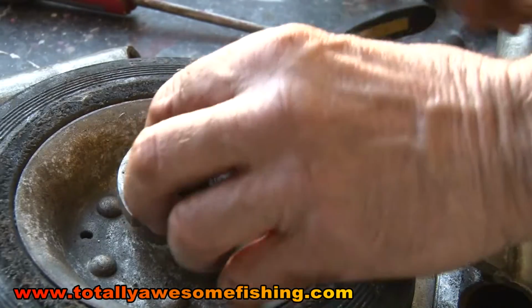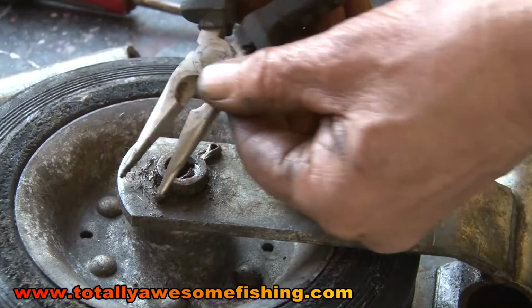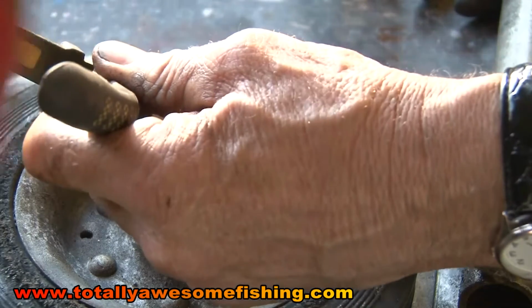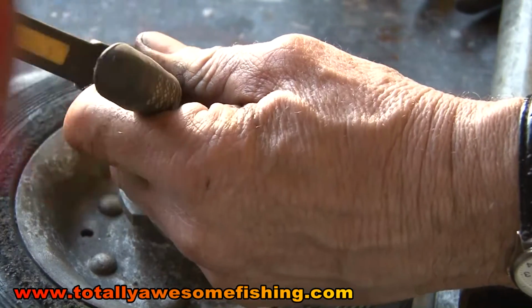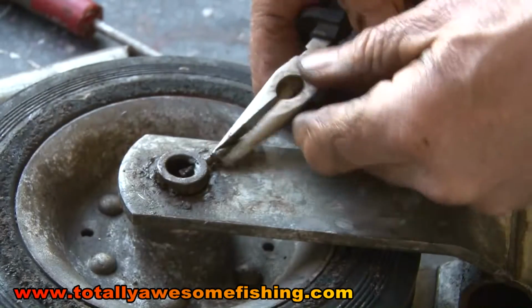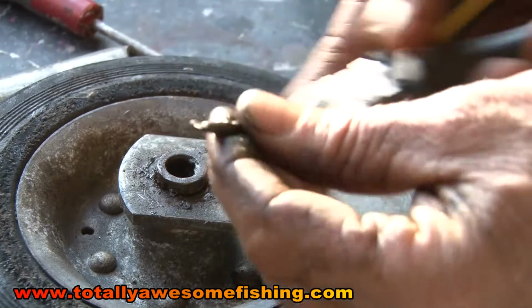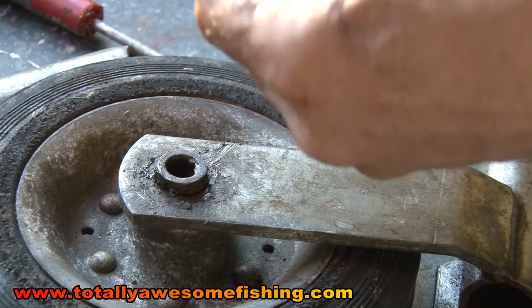Now you might actually find that split pin, I've bent it back, squeezed it here. When you get that split pin, I'm just going to tap it out. I should use a little hammer. If it comes out pretty clean, which this one does, and it's not showing a great deal of corrosion because it's stainless, you just straighten it and you can use it again.